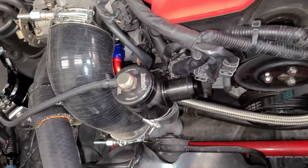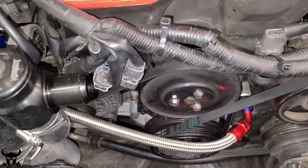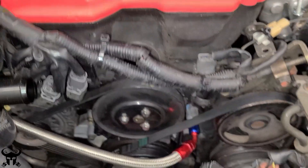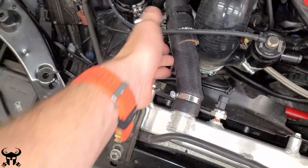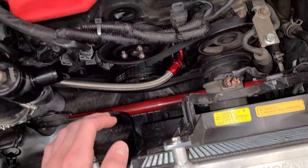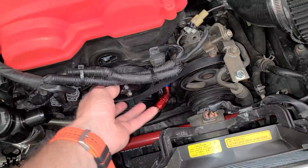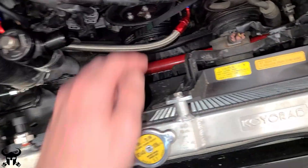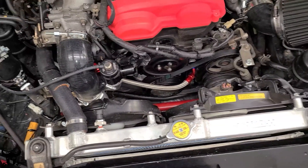It's just this short line. This is the throttle body. I took off the coolant neck - there was originally a coolant neck there. I have the coolant reroute made by Flying Miata and Super Miata. There are a couple of them on the market and it allows you to eliminate this coolant connection. The neck was just serving as a T for two hoses, but now I replaced it all with one AN line - I think this is AN6.